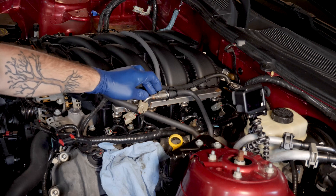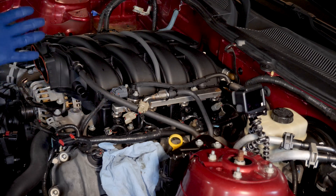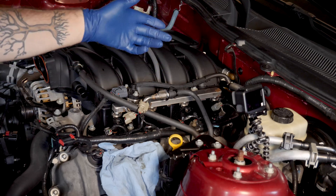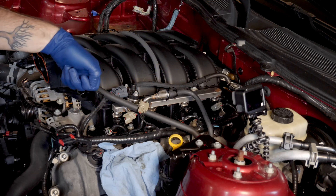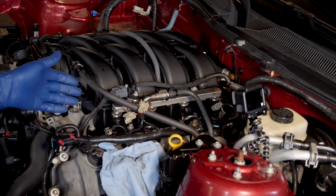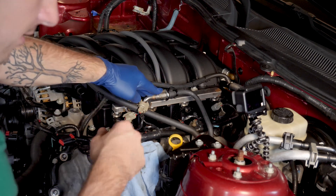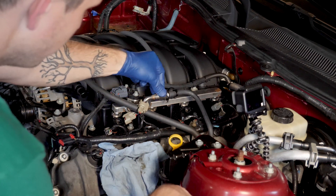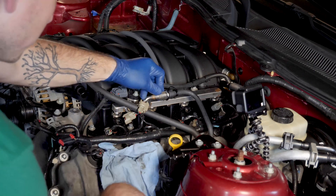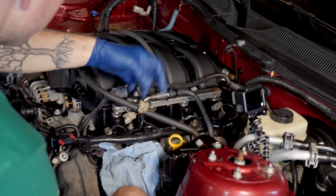You want to start by depressurizing your fuel line. If you're just taking off your fuel rails and haven't taken anything else off, the proper way to depressurize your fuel line is to go take the fuse for the fuel pump out of the fuse block and then run the car until it stalls. Once it stalls, continue to turn the key — I think about five to seven seconds — to make sure all the pressure's out of the line. However, the whole reason I'm doing this job is to not run the motor, so this is technically still pressurized. I'm going to take off this safety plug and release it with pressure in the system. I'm going to absolutely ensure I'm wearing eye protection, and I'm going to wrap this area up with paper to eliminate getting fuel all over the engine.